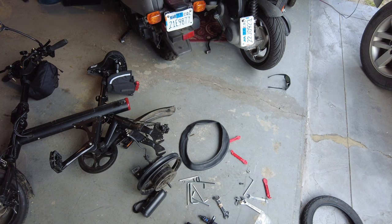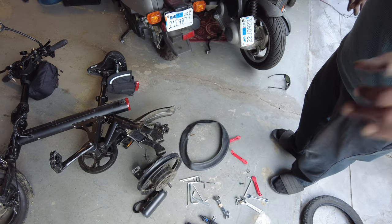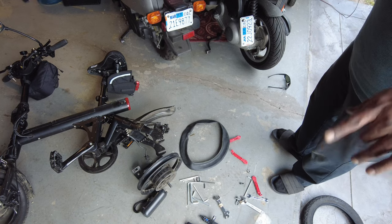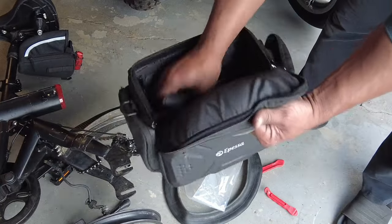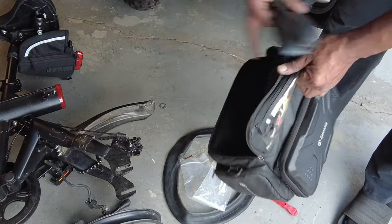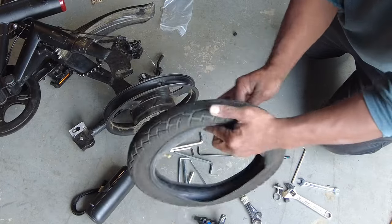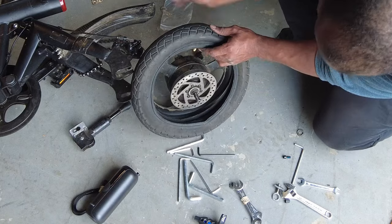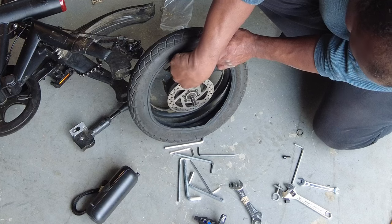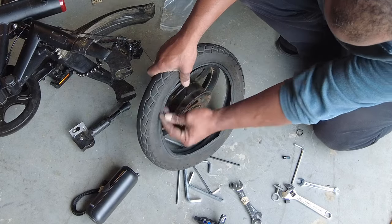In keeping with our theme here, technically I'm supposed to be able to fix this bike with things that are on the bike, and I may have to cheat here because I didn't have the front bag with me. The front bag has the extra tube — it's supposed to be in the back. Put the inner tube inside the tire first, then align the valve, and I like to take the valve cap and screw that back in. So now that's the only thing holding it in there — it gives you a place to start to work that bead to get it back in.